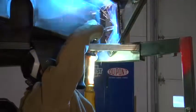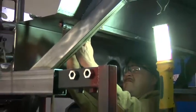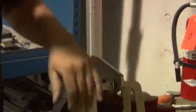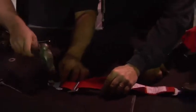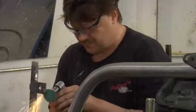And the struts in the front for the COT, the braces we call them, are made out of billet aluminum. They're really special just to what our needs are. There's very few items on the car that have anything whatsoever to do with a factory-built manufactured car. There's a lot of regulations to make it street legal. It's got to have DOT headlights, tail lights, windshield wiper, padded dash, padded sun visors. There's a lot of safety items that got to be done on it, and it's no different than anybody else building a street rod of any sort.